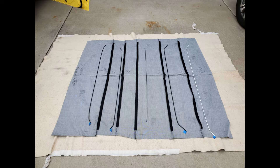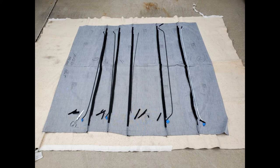When I removed the headliner bows, I marked the position they were in and also marked the hole they were in so I could put them back in the same place. I also gave them a quick scuff and a spray paint. I laid the bows alongside the sheath that the bows slide into, and then cut the sheath back about halfway down past where the bows bend.